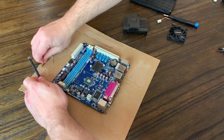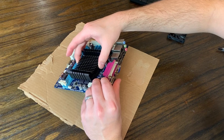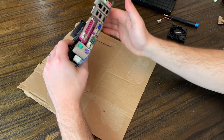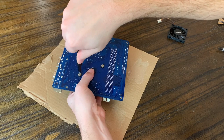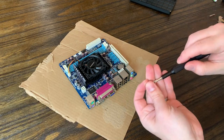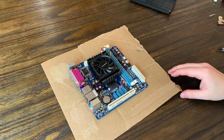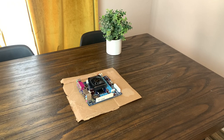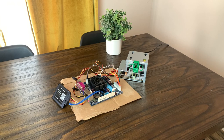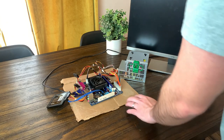I forgot to grab some extra paper towels, so I'm just going to tear off some of my test bench here to clean up my spudger. Now we can put the heat sink back into place, line up the screws with the screw holes on the bottom of the heat sink, flip it over, and tighten those screws back until snug. Then we plug the fan back into the header on the motherboard and use the two screws to screw it back into the heat sink. After this we're done — we put our motherboard on the test bench and add in our $5 Amazon 240-watt power supply, a 128 GB SSD, 4 GB of DDR3 RAM, and a monitor. Then we short the power header pins and see if this posts.